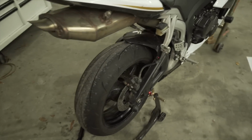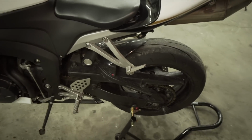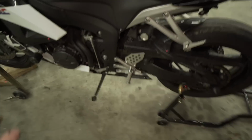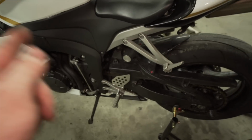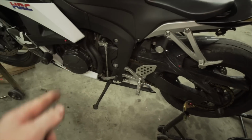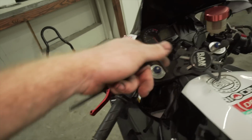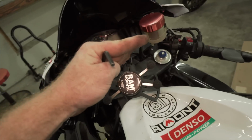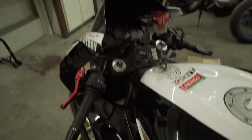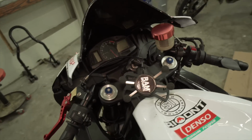So I just got done, and it sounds like the noise from the chain/transmission area is significantly quieter, but it's still there. But loosening and lubing it actually helped, so I'm thinking it's just the chain. So I'll get him to swap that out ASAP. And then, unfortunately, I actually tweaked it the other direction. So it was tweaked slightly this way, now it's tweaked slightly this way. So I'm gonna try to loosen everything up just a little bit and tweak it back a hair.